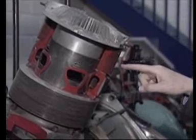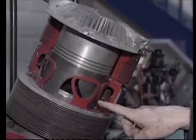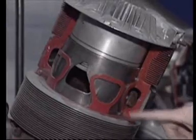Here you can see the sleeve sliding inside the air-cooled cylinder. With the port open here — that's an exhaust port — and there's the piston at the end of the piston stroke, pushing the exhaust gas out of this cutout which goes to the exhaust pipes here.